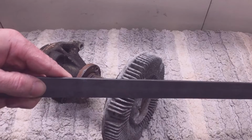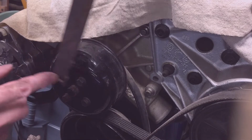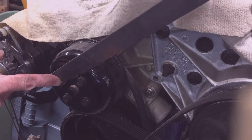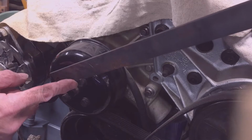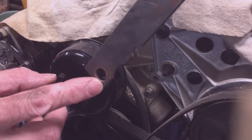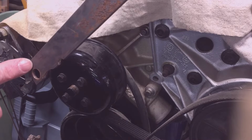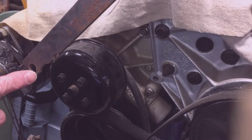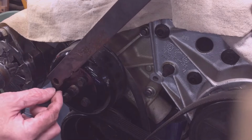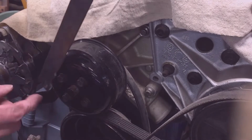Let me also show you this over on the 5-liter. Holding it this way, this hole is set up for a 10mm. These are 3/8 bolts, 3/8 head size, so it won't quite fit on here, but you can see what I'm trying to do. It comes around and it hits that second bolt head right there and holds against that. So you need to have a little bit of meat right there to hold it, and then it hits right there. So really this is kind of extra material here, but you need that to be larger right there so you're not breaking it, but it can't be too large so it can fit on that nut. So it needs to be about 1/8 of an inch of material right here for this to work. And this one worked just fine.